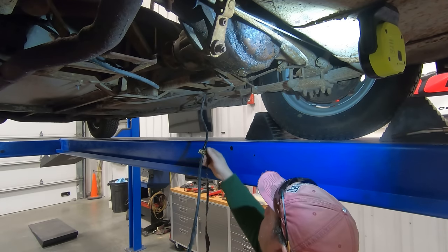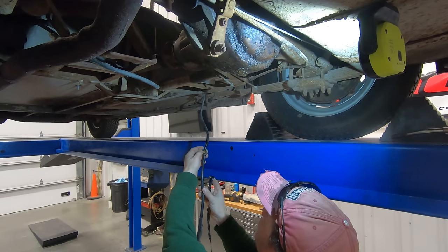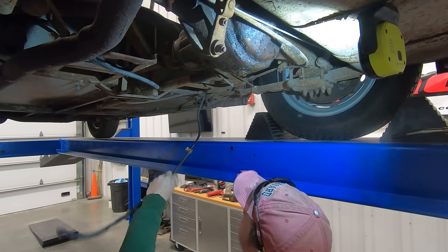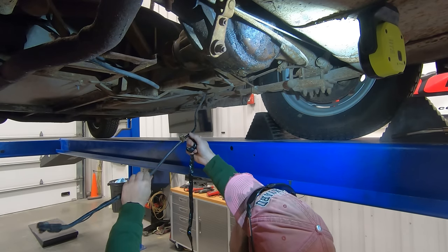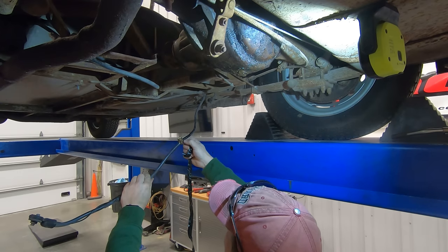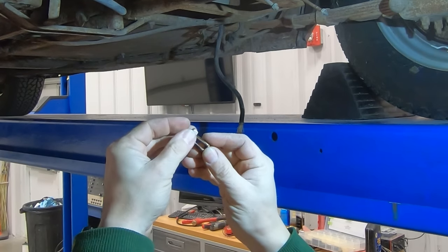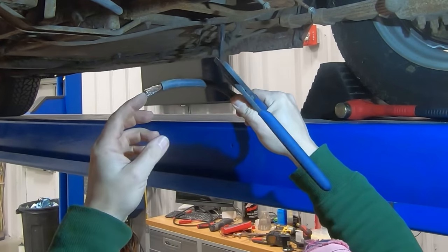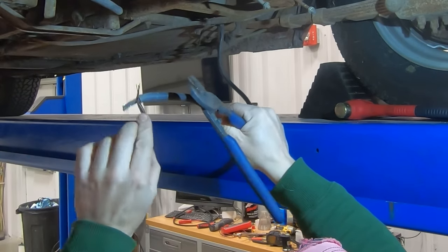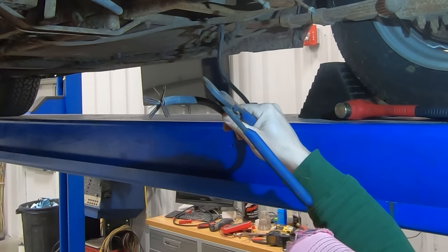I didn't expect to find this — actually neither side of this cable has a terminal on it, but it does use a battery cable quick-connect. Over the years there's gotten some corrosion in between the wires, so I'm going to take this apart and redo it. You can see how it worked — you slip two wires in there and tighten this nut down to clamp them together. I cut this end off but there's still a lot of corrosion, so I'm going to keep cutting it back to find a clean piece of metal.